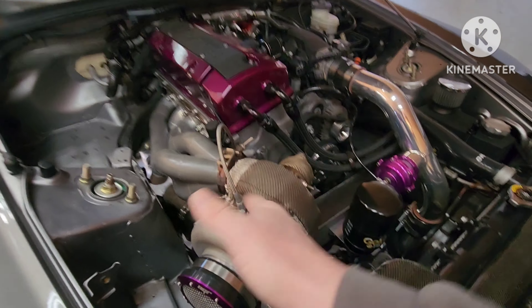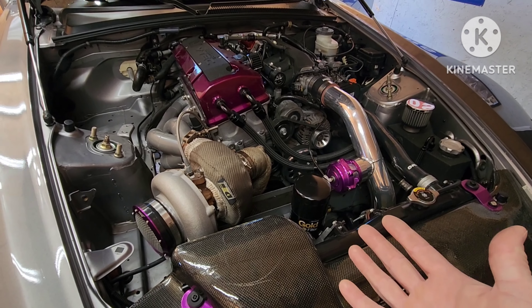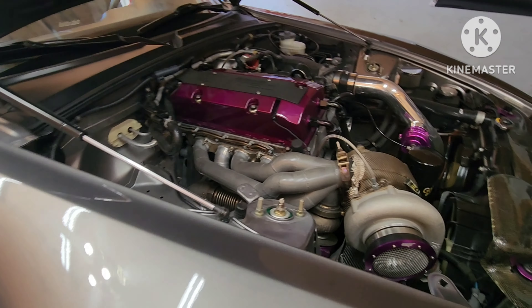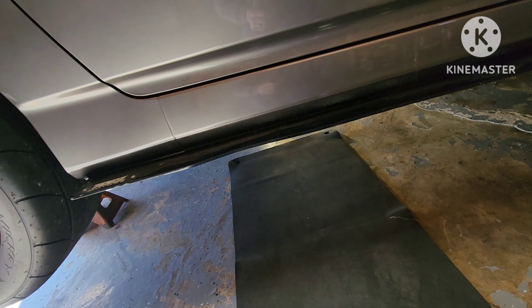Next time I do it I'm probably going to pull the turbo manifold and all that. I'm half-tempted — it makes you just want to drop the whole subframe and everything. I feel like that might be easier. Hopefully I don't have to do it for a while, basically until we go to a twin disc clutch. But once you get the input shaft angled right and it got up over the fingers on the pressure plate, it damn near fell into the car. After that it was absolutely easy.